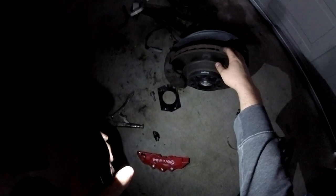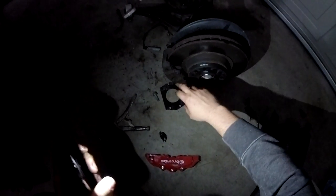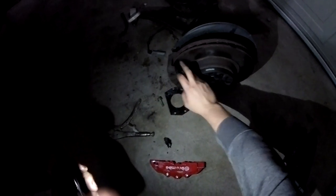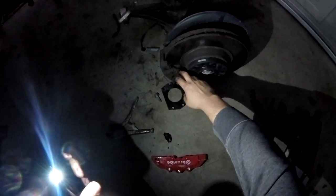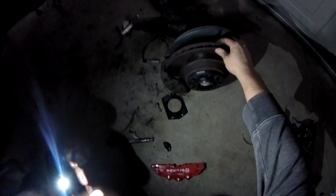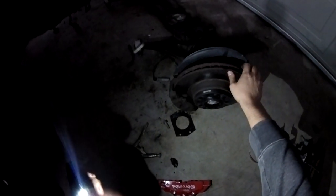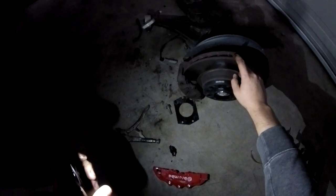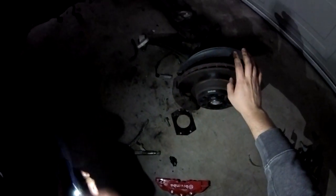Until I get a brake sponsor of some kind, which I have been in contact with a few, I'm probably just going to switch to race compound rotors and race compound pads, and they should be good enough because we're not doing any kind of racing where it's non-stop racing for 40 plus minutes. Most track days you only go out on the track for a session of like 20 to 30 minutes, and most time attack events you only go out for a few laps, and one of those laps has to be your main time lap. So just doing race compound on stock M3 brakes is going to be more than enough.